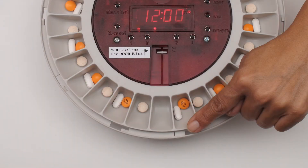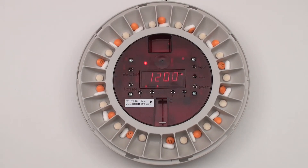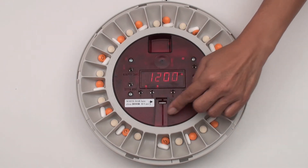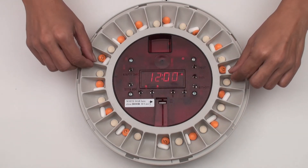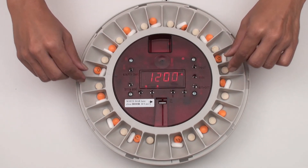After loading the tray, position the empty cup to the left of the alignment mark so the cup walls line up correctly. To test the unit, press the alarm test button and the tray will rotate. Slide the white bar up until you feel the click to shut off the alarm. Reposition the tray so that the empty cup is again to the left of the alignment mark.